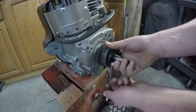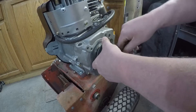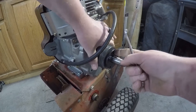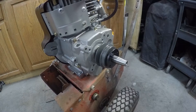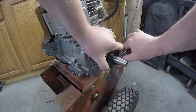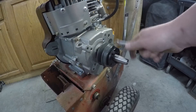I'm not using a ratcheting wrench or a socket, but you're just going to keep alternating between the two, pulling that bushing deeper into the pulley — that's all there is to it. I'm going to have to find a way to hold my engine still so I can actually get these torqued down. There is a torque spec for these; I'm going to look it up just to make sure I get them tight enough.